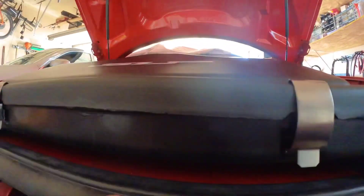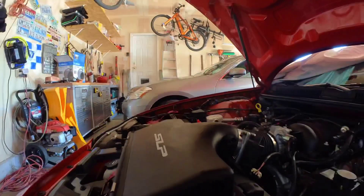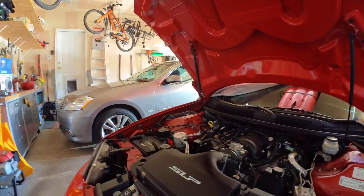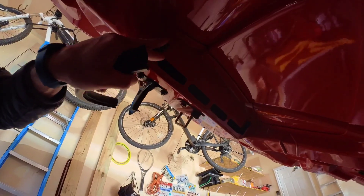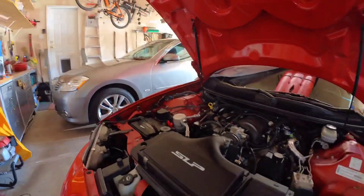You get quite a bit of airflow coming through here from the hood scoop, but when you measure the airflow coming out through the filter — which is what your engine is really going to see — it's definitely not as good as the cold air intake. I'll show you the video with the numbers. When you look up here you've got four holes and some weather stripping to try to seal it off, but it doesn't do a great job. It really does work, just not very efficient. The cold air intake is actually quite a bit better. I just wanted to dispel some myths and put a little science to it.